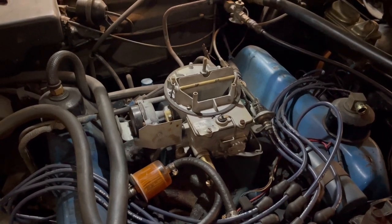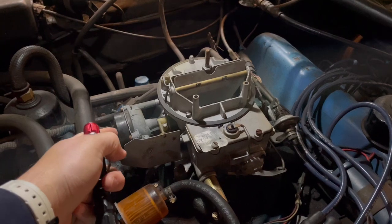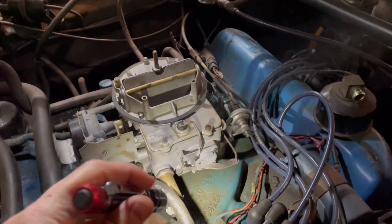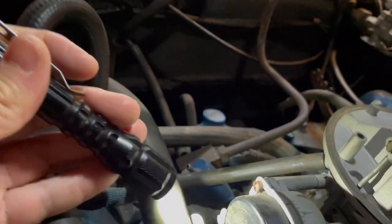We're going to start taking apart this carburetor. First thing to do is get it off the car. You can see I've already moved the heater hose outside from the choke housing. Got to take the fuel line off, got to take the kickdown linkage here for the transmission off — the kickdown rod, the throttle cable. This just rolls off; you twist it off. This one has a little clip you can see right there, and then there's the choke heater down there, that's usually a half inch — you can use an open-ended wrench.